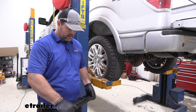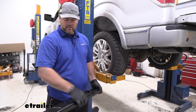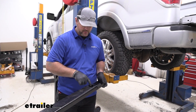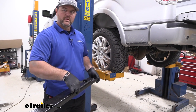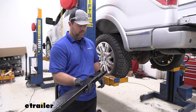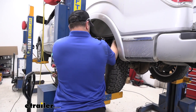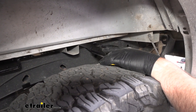Next, we're going to put in our base rails. We're going to have a front and a rear, and they should be marked. If the sticker's not on there, the way you're going to know is this is going to be the rear one — you can see how it has this rolled side. Our front one is just going to be a crossmember and the holes are just going to be small; they're not going to have these larger openings in them. When we slide this in, we want this part to go towards the hat channel or towards the front of the vehicle. We want this section to be facing up, this flat side to be down. We'll go in between our frame rail and the edge of our bed, get this set in here where it's secured, and slide it up on top of the other frame rail over there.